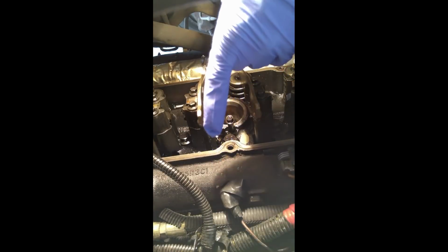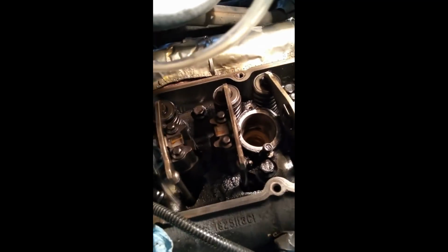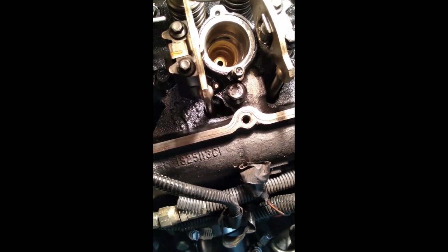But there is one last thing we need to be careful of. You see, there's actually a very small hole inside of the injector cup where the injector nozzle actually passes through into the engine. It's through that hole we have direct exposure to the cylinder itself. You can see it right down there, nice and hidden. And if we're not careful, we can actually hydrolock the engine, crack pistons, and have a whole world of mess. So the solution is use advanced technology of the shop vac.